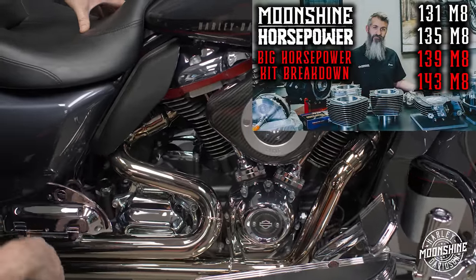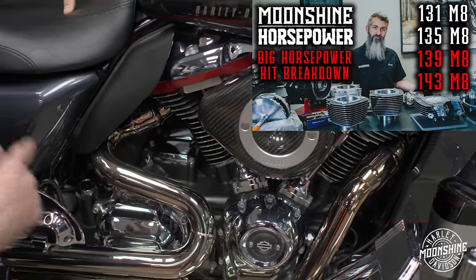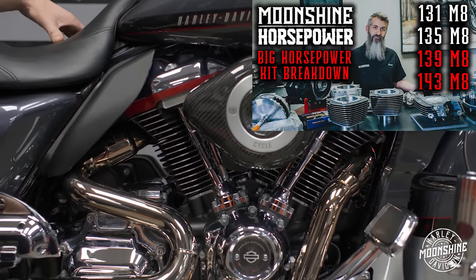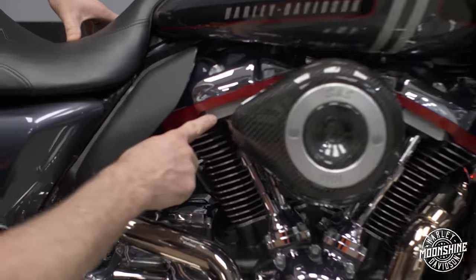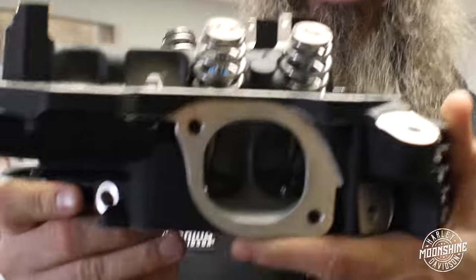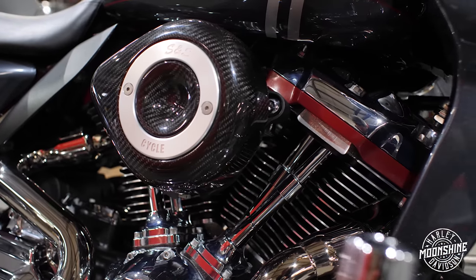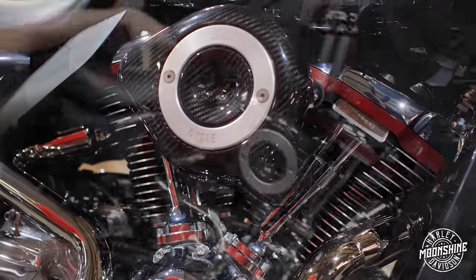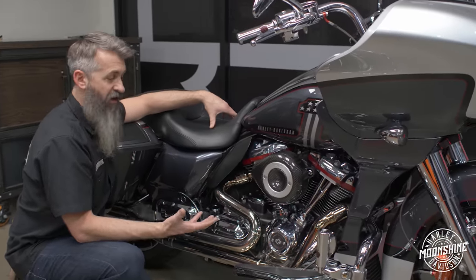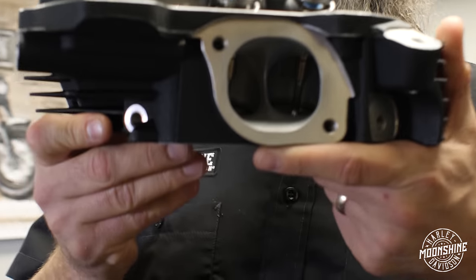Here's a video of them — Moonshine Horsepower right in the top, they got a dome. We've talked about these in some of our other kit breakdown videos. If you need more info on the complete breakdown of the kit and everything in it, please click it. The heads on this guy are the Moonshine Horsepower Monster Heads by Frankenstein Engine Dynamics. Please go check out their Instagram — they are Frankenstein Engine Dynamics. We have teamed up with them as one of our partners. This is the Monster Head plus 2.5 millimeter valves. Anything 135 and up, we're going to the Monster Head with the big plus 2.5 valves.